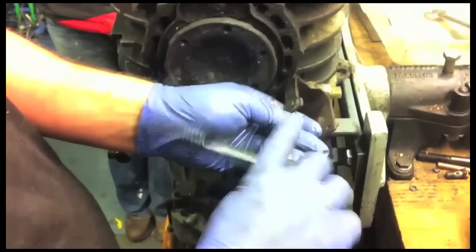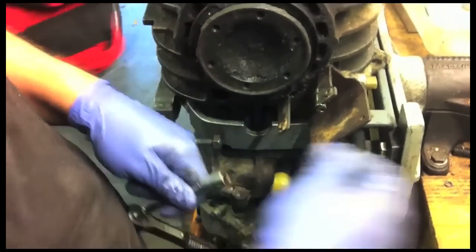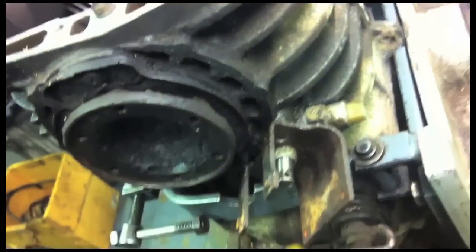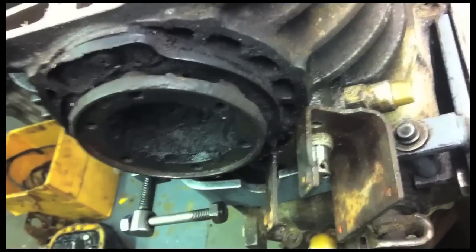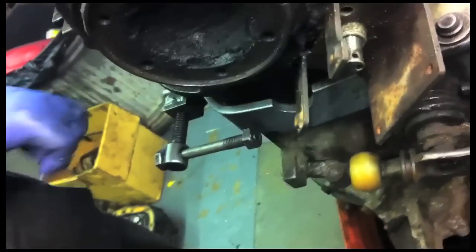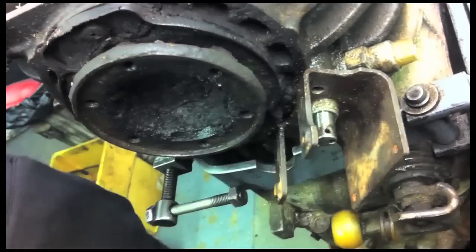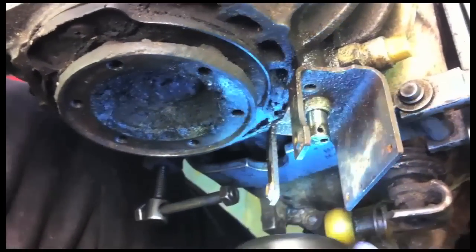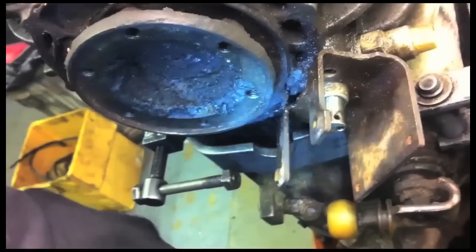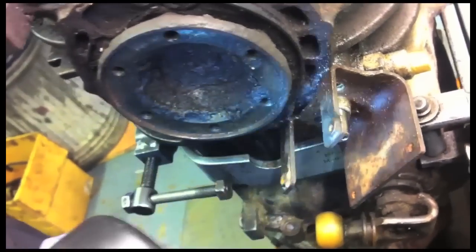And it's just taking off the actuator bracket there. Bracket's in reasonable nick. The two M4s are intact. This is another difference which I was chatting with Aidan about yesterday: you see some boxes, the later boxes you said, Aidan, have got this larger, longer bracket on them? Yeah, this is post 86. Okay, only the very early ones haven't. So very early boxes have got a shorter actuator bracket, and the pin's short. It's the same length as on the front diff. Right. It's the same pin as the front diff. So it disappears into the sleeve.